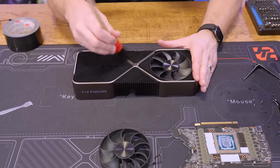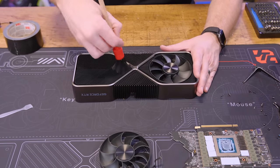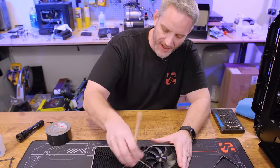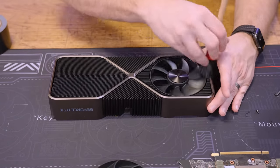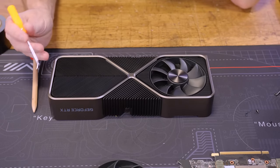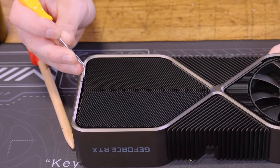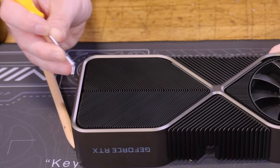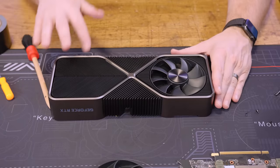So this fan is all clean now. All I'm going to do now is take the brush and kind of work it into the fins — this is more about aesthetics at this point. This is about getting out the dust that's stuck in these fins, and this is going to work for any aftermarket cooler. The idea here is getting it to look all the same color — if there's gray, that means there's dirt and dust stuck in there. I'm just kind of going along with the grain and working out any of the dust. And what I'm going to do is, by handling this, some of these fins have been bending — I'll just take a pick tool and bend these fins back into position. I'll work my way around and make all the fins look good again — it's worse on the backside than it is on this front side.